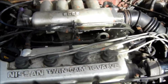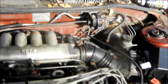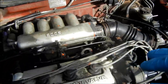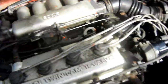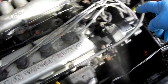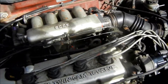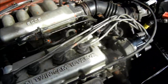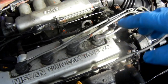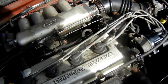Anyway, I swapped that injector, took this off, put it all back together — it's all back together now, it just won't start. I checked this plug here and we've got spark, so the coil is good. The primary steps are: make sure you've got battery power, make sure you've got spark, and make sure you've got fuel. You need to check both spark and fuel and make sure you've got a proper mixture.